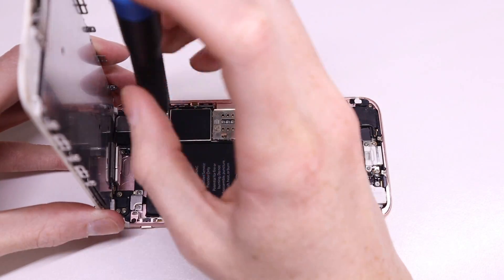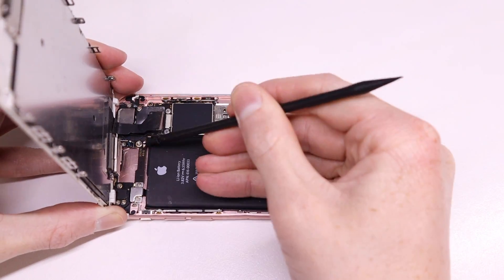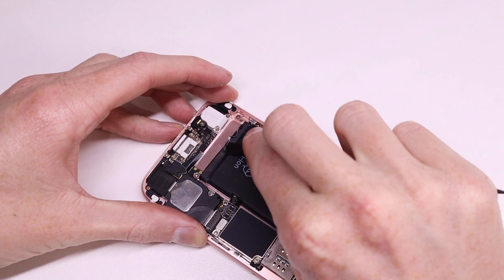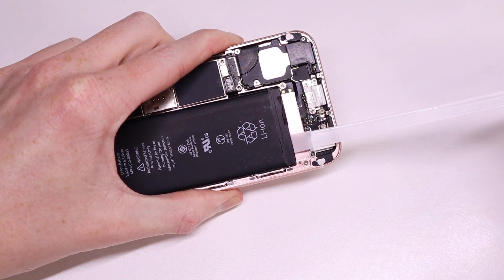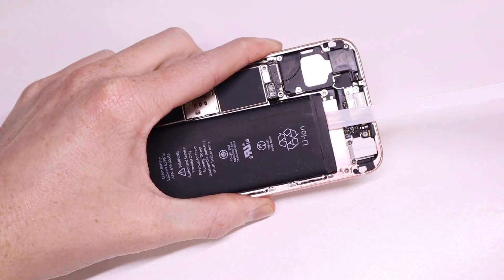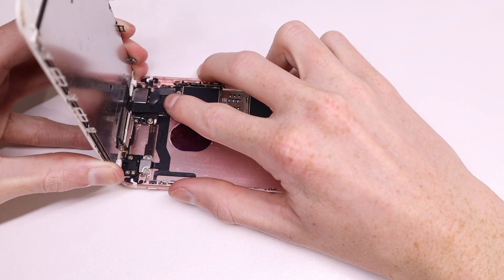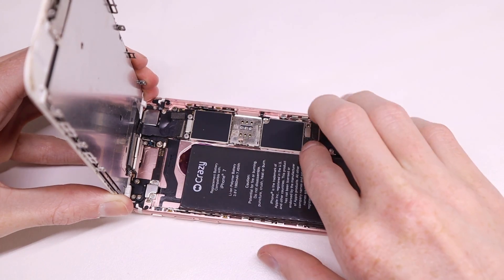The first thing I'll need to do is take out the old battery, making sure to disconnect it first before removing the display as I don't want to fry anything on the board. Next I'll need to remove the Taptic Engine, which will give me enough clearance to access the battery tabs much easier, making it much less likely to damage the tab when pulling it out — which would otherwise require a lot of prying to remove the battery. With both tabs now removed, the battery falls free and I can take this knock-off Apple battery out of the phone. Reinstalling the display, I can now test out an iPhone 7 battery — just a replacement aftermarket battery — in the iPhone 6s.